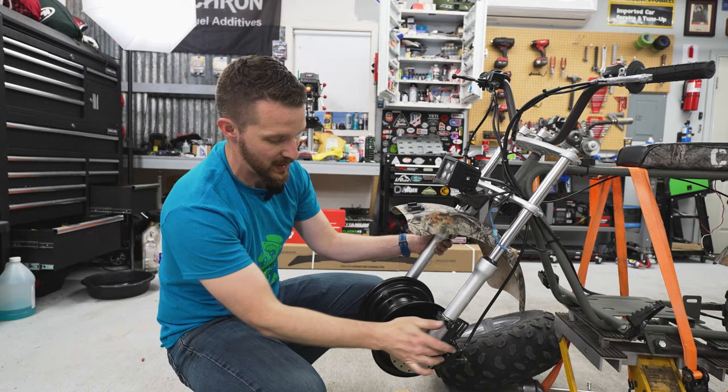The original bolt is not going to work because this sticks out farther — and the bolt was very deteriorated anyway. So I went to the hardware store and got a 5/16-24 grade-eight bolt, which is quite a bit longer than the last one and slides in just fine. This is going to be way more secure. A lot of the holding power was in the first several threads, so this is going to be a lot safer — which is good because we have a lot more mass to spin. The only negative with the Juggernaut pulley is that it makes changing belts a little bit harder, but the easiest way is to just kind of force it on there. And that wasn't that bad.